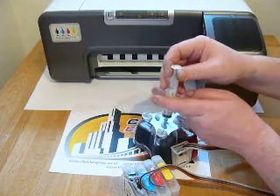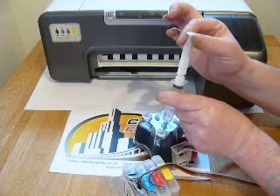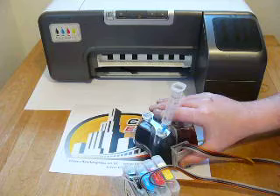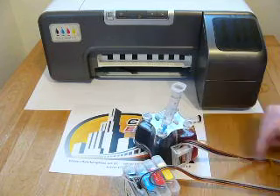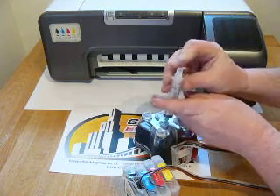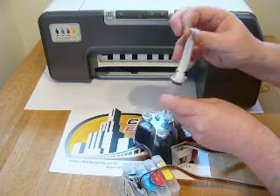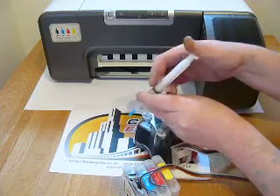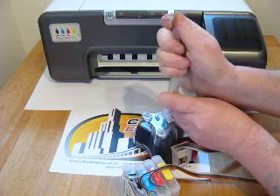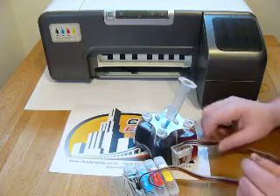On the last pass, expel the air and then separate the plunger from the syringe — you'll probably hear a little gush. Make sure the roller is in the up position or it won't work. For the video I did forget to put it up, so the ink hadn't travelled down the line, and I had to repeat the process. Just do it quickly: remove and expel the air, remove and expel the air, make sure it's on firmly, then on the third time pull the plunger out and leave it in that position for about 15 seconds. This removes any excess air from the ink lines.